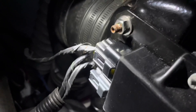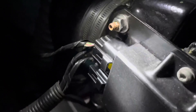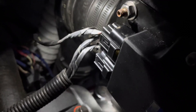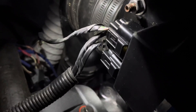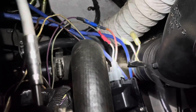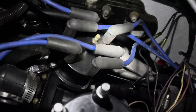The gray wire also comes up to the Thunderbolt connector right there, which I'm just going to abandon in place. I'll pull these connectors off, remove the module, fill them with silicone sealant so nobody tries to put them on again, and leave some of the wires abandoned in the harness — I'll cut some and some will just be abandoned in the connector. As far as the power wiring, it's all done. I could crank the motor up now if I wanted to.